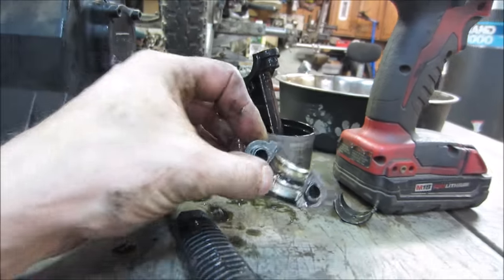Quick look at those reed valves. A reed valve is like a one-way check valve — it's spring-loaded, allows air to go one direction, and when pressure goes the other way it blocks it off. So there are two sets of reed valves — one goes one direction, one goes the other. It allows air to come in this way and out the other way when pressure goes the other direction.